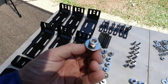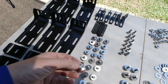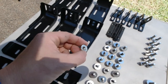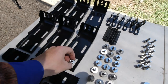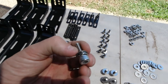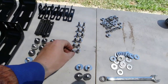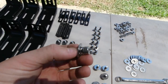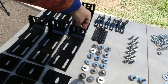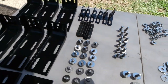All the fasteners look pretty good quality — they all appear to be stainless steel. The shorter ones, I think they're 15mm. A spring washer and flat washer go through these brackets with a lock nut type arrangement on the back that actually bites in and grips. The ones that go into the roof are the slightly longer ones — same thing, spring washer and smaller flat washer — and these go through the mounts down into the roof. The longer ones with the bigger washer go through these cover plates on the outside, through the roof rack mount, through the roof mount, and into a nut.